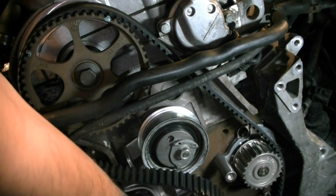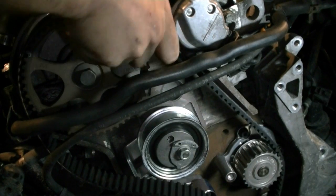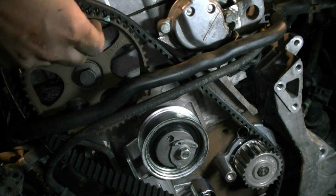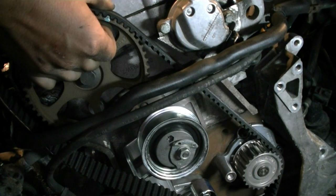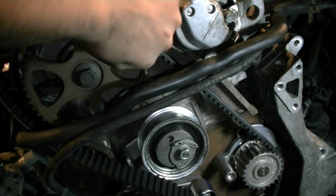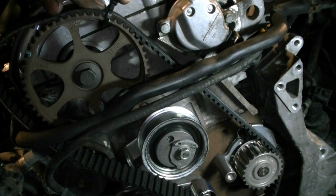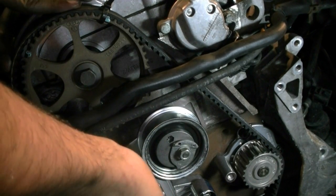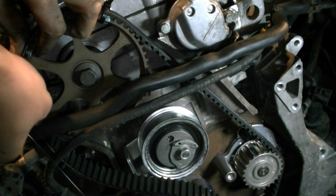I don't know if my camera is going to zoom out far enough for you guys to see exactly what I'm doing, but basically you get the bolt off here, make sure it's off, and you just pull it as tight as you can. Just when you think you're going to start moving the crankshaft, that's when you press it down. Hold it here with one finger, get your zip tie, get it around here, put it on, tie it down, and then do the same thing a little bit further back so you're sure it's not going to move while you're trying to get it over the tensioner.